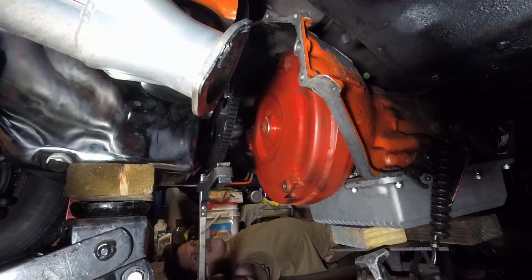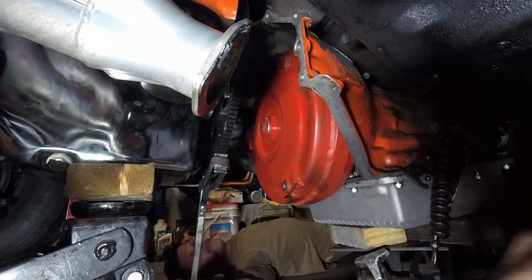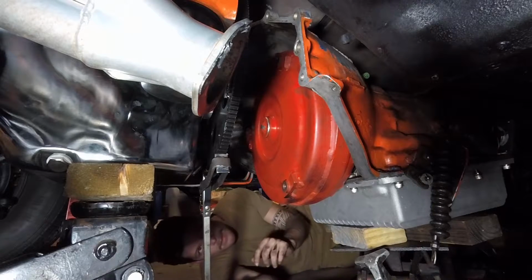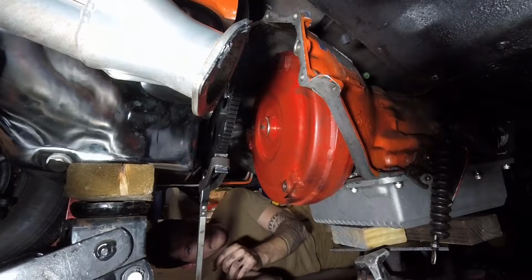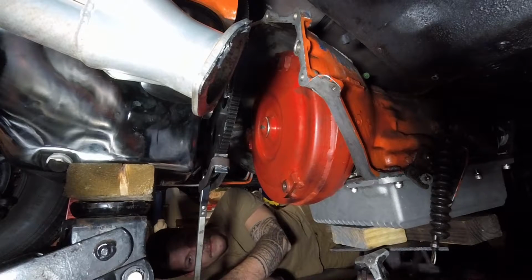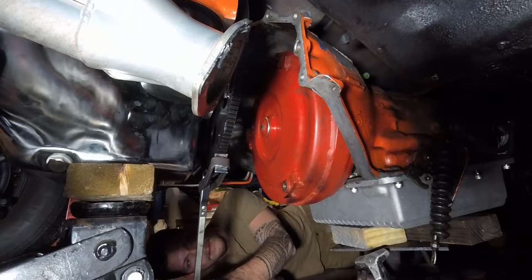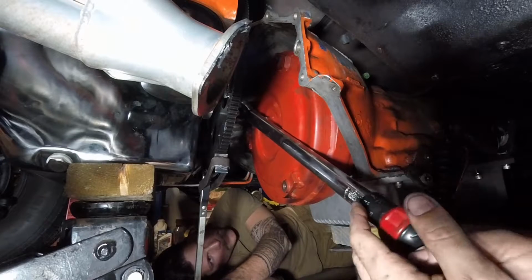All right, so they want 85 pound-feet. Yeah, there you go. So they want 85, so we should do... What are we doing? 40? Well, we should do 45, 65, 85. Let's do 35. That's like hand tight. 68 inch-pounds is hand tight. It's like 12 foot-pounds. Did you put washers on there? No. All right, we'll do 40 then.